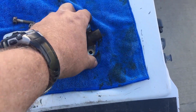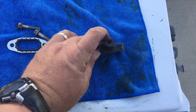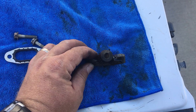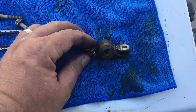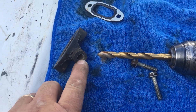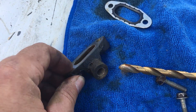Here's that piece I pulled off just above the oil filter. I'm gonna drill this part out and tap it with a 1/8 NPT thread — that'll be where our oil feed line hooks up. You can see it's blocked off right now, so I'm gonna drill that out.